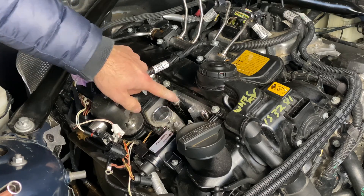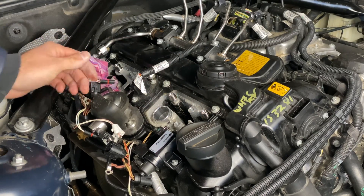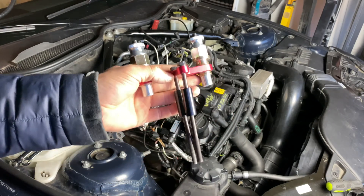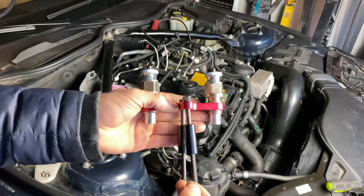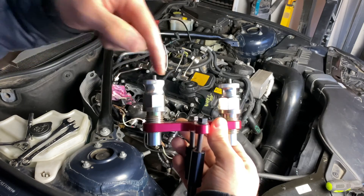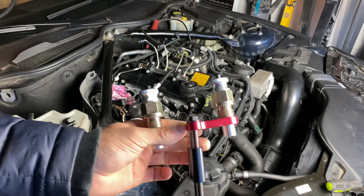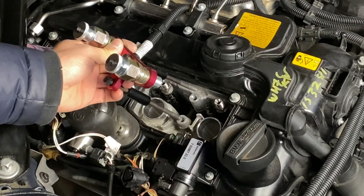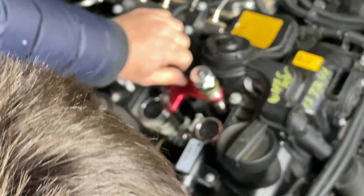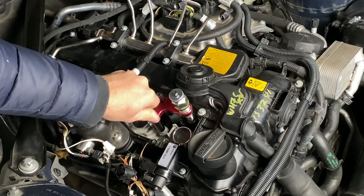If you're super lucky you can just pull out your injector and you're done with the removal. I am not super lucky, so we're going to have to use a special tool — a specialty BMW injector tool. You can find links in the description; you can get them much cheaper on Amazon. BMW wants a couple hundred dollars for this — I think I paid like 30 or 40 bucks. First step is to screw it in, because it's a left-hand thread, into the starting position. Now insert the two long bolts into the holes in the cylinder head until they're almost touching the injectors, then tighten these bolts in by a few threads.